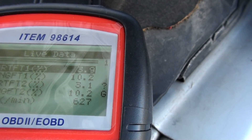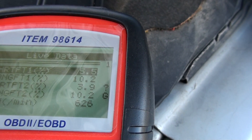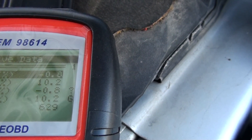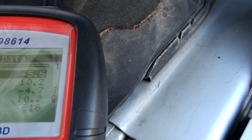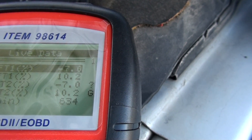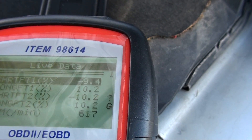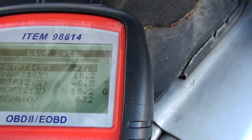Anyway, you can see the fuel trims are continuing to go down — it's trying to get back to 0. But when I turn this on, you can see how it takes fuel away. Now I've got it on just part way — starting to take it away. As I turn it on even more, it's taking away fuel. So I don't know what this means as far as driving around town, but I'm going to give it a little bit of attention and see if we can make something happen with gas mileage. Who knows — there may be a whole lot of potential with this in the HHO.